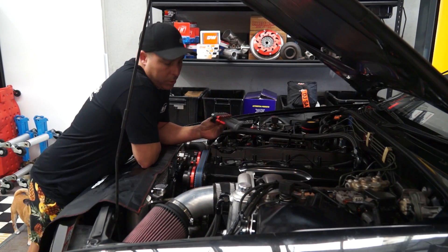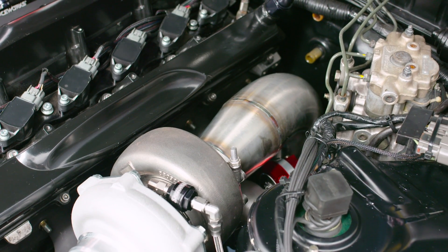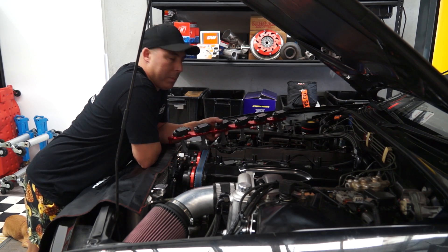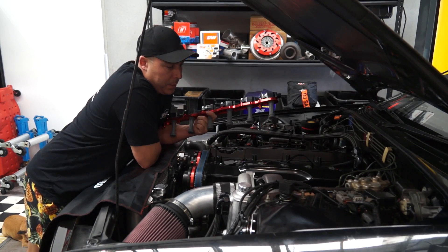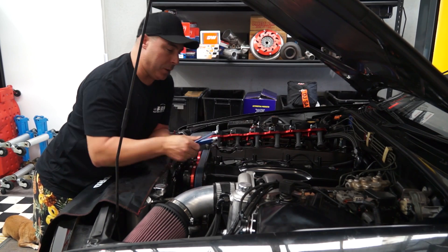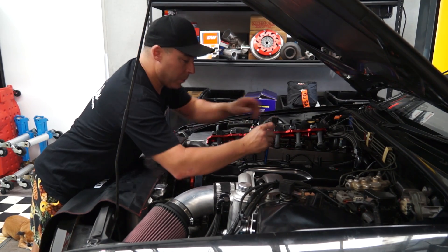We're about to swap over a set of coils. This is a Gen 1 coil kit in Andrew's car here. We're about to swap it over for what we call Gen Next — now we're just calling it Next because this is just pretty well perfect, I think, and we're marketing it as our Generation Next. It fits well and truly under cover, sits well and truly under the V-cam sensor if you're running V-cam on the inlet. It fits well in the cover, well between the rocker covers. We've straightened the coils up a little bit, and it sits 12 millimeters further into the spark plug well, so it should just drop in really easily.